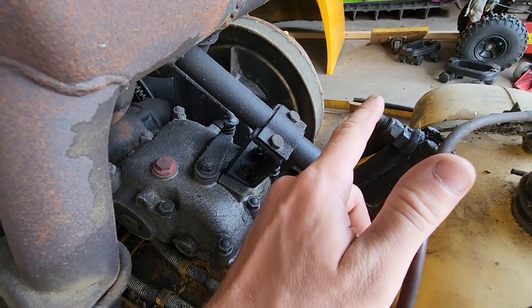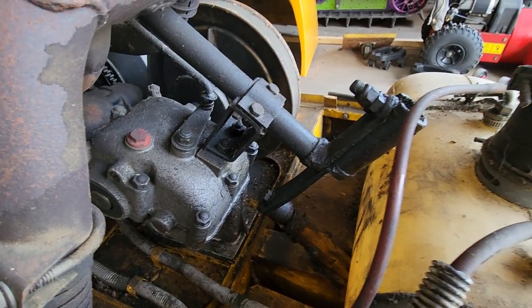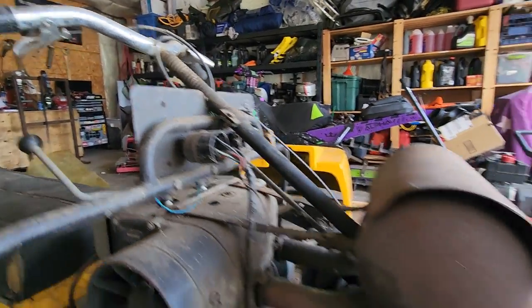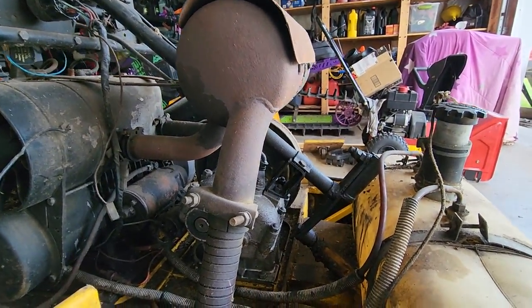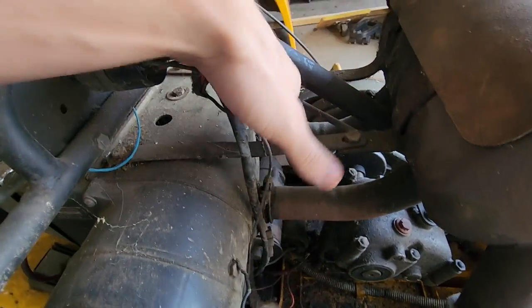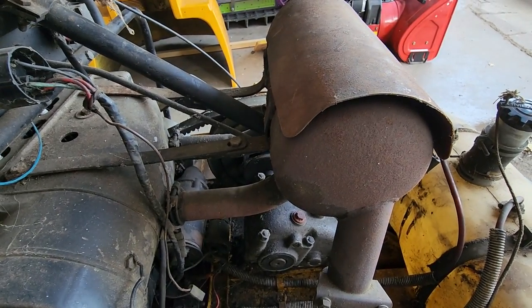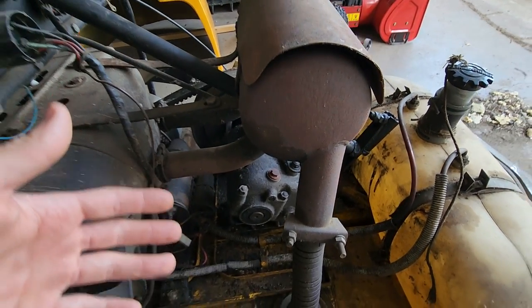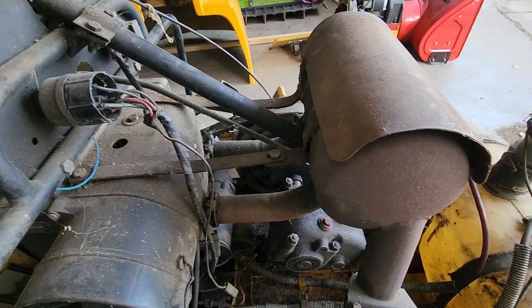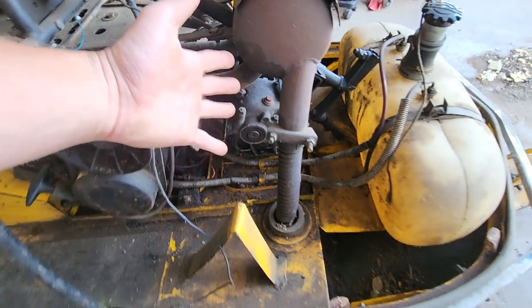Moving up from there, we have our steering linkage. There's really no adjustment on it — if it's not aligned, it's bent. Exhaust system is super primitive. It is a twin, so you have two exhaust pipes going to the expansion chamber, the can. There's no real distinguishment between them, and then it dumps into the tunnel — we got a tunnel dump.